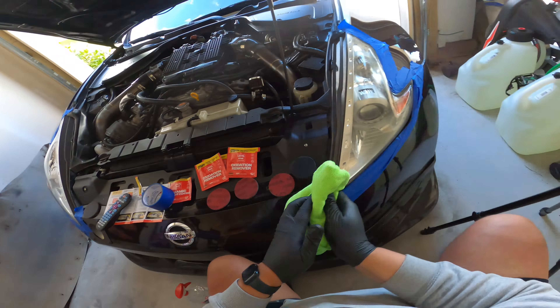Time to wipe it down. Now we're going to use 1000 grit with some water. You do this for like three to four minutes. I like to go one direction first and then switch it up — go up and down, then start going left and right. The 370Z headlights are a little annoying because there's a little hump right here. I'm not doing crazy pressure, just slight — just make sure it stays wet.